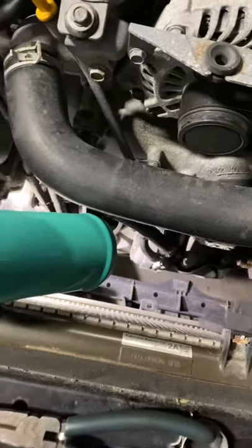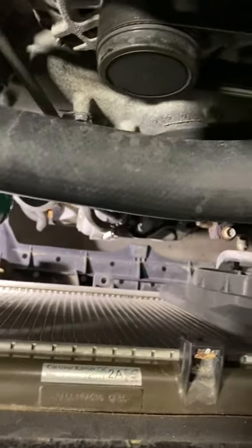When you're putting the new Perrin flange on for the charge pipe, you need to reuse your old gasket from the original charge pipe flange. It goes on with two 12 millimeter bolts that they supply you with brand new ones. In with the new.